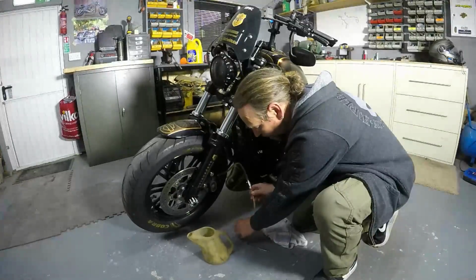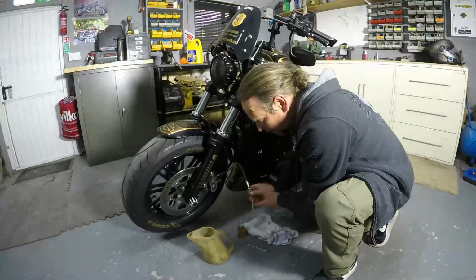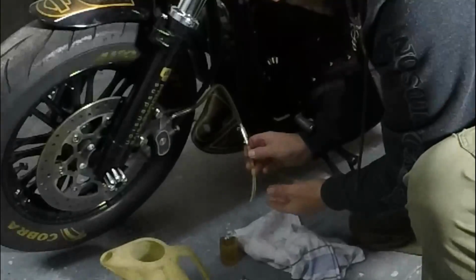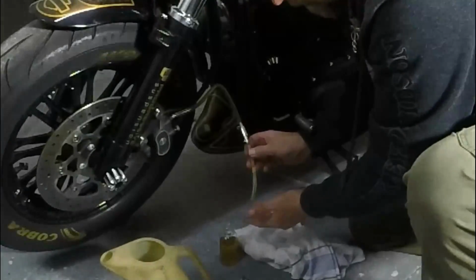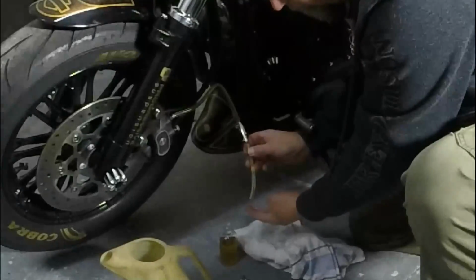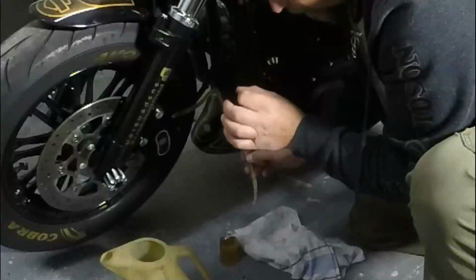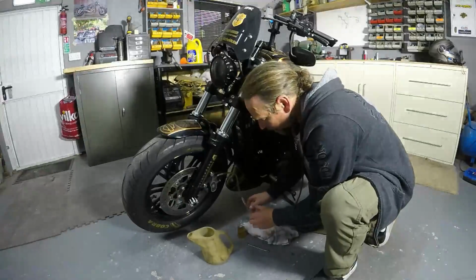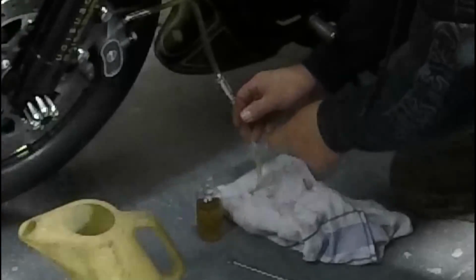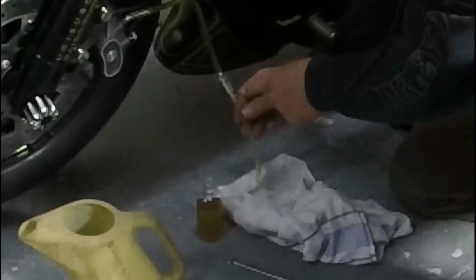Now, you can see how the one-way valve is working. There's still fluid in the bottom of that line. The valve is holding well because we had one drip from there, just from the bottle. There is nothing dripping out of that line, so you know that valve is absolutely spot on. So there's no way air is going to come up. You can see these bubbles here now, just put it down on the ground. That's what you don't want, but it won't go past there.